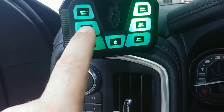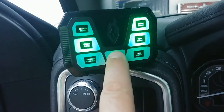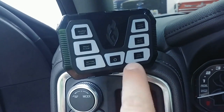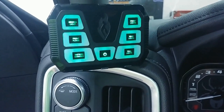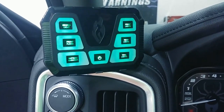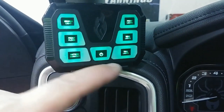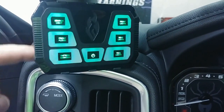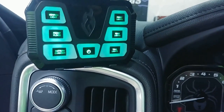The way this controller works is pretty nice too. If you have multiple switches on and want to kill everything with one button, just press the middle — it'll kill everything. Press it one more time to put it into completely off dark mode, or leave it on standby with minimal draw. For those who like the technical specs: this entire system, front and back, draws 4.2 amps total. I didn't individually measure each channel, but I could on the next video — throw a comment in if you want me to do that. The pattern changer would draw zero, of course.